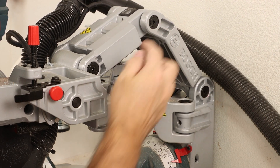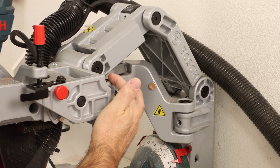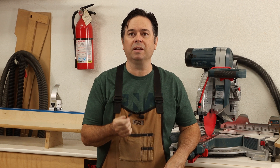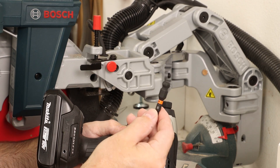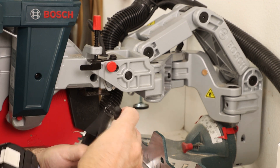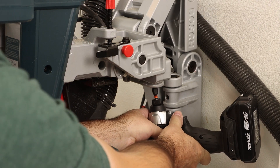There are actually four knuckles you can easily adjust, and then there's one that's a bit tricky because you can't get that 5-millimeter Allen wrench on top. The one special tool you may not have is a 10-millimeter Allen drive bit — I'll put it in the description. If you have a small impact driver it's super helpful. It's a ball-end bit that's a 10-millimeter Allen wrench, and that lets you snug this up from the underside. Even if you can't get perfect access, the ball end helps if you're slightly at an angle — just give it a light tap and that'll tighten things up.